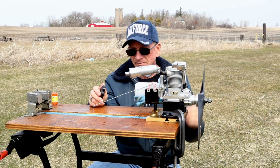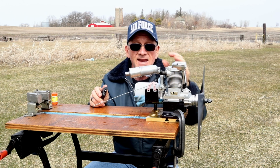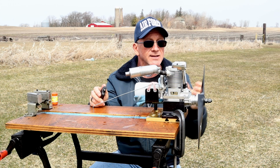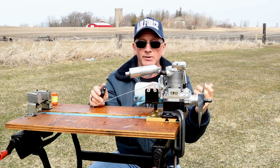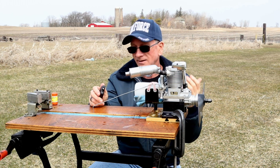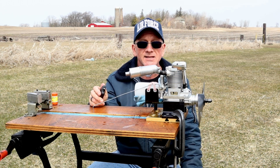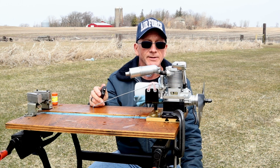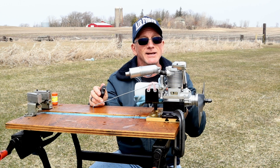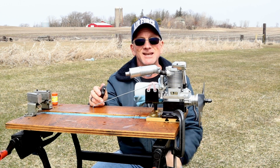But this engine runs really, really well. It's a really nicely behaved engine. It didn't backfire or bite my hand or anything like that. It has to be pretty wet when you prime it, and I think it needs to be a little bit warmer. If not, use some lighter fluid in there. And it's a pretty easy hand starter once it's primed properly. So I hope you enjoyed watching this video, and I know I enjoyed making this video and hearing this engine run. Thank you for watching.